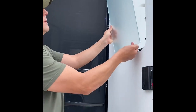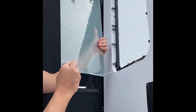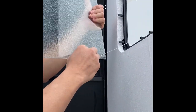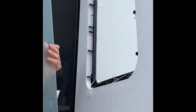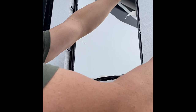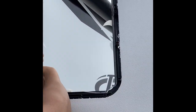As you can see when we remove the window, you need to release the tape, then you're gonna pull the glass out. You'll see that it has a seal here so it's not gonna fall out on its own. But it's gonna be delicate — take the glass out, take the seal off, that way you don't break the glass. Now that we got the glass removed, we'll go ahead and just release the snap off the door and it'll come right out.